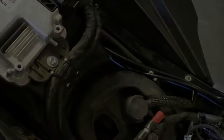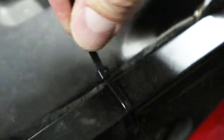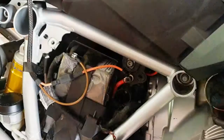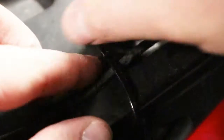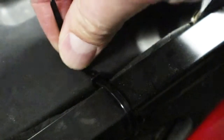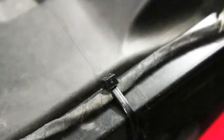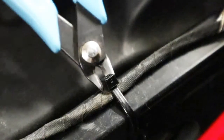It's very important to make sure your installation will be 100% reliable. Wherever possible, make sure that the EZ-Can wiring runs alongside existing electrical wiring. Use cable ties to fasten all wiring, and make sure you mount the EZ-Can main fuse holder in a location that is easy to reach. Fasten cable ties by pulling the loose end until there is slight resistance — when tightened, you should just be able to rotate the tie. If the insulation of the wiring has distorted, the cable tie is too tight; cut it and use another one.